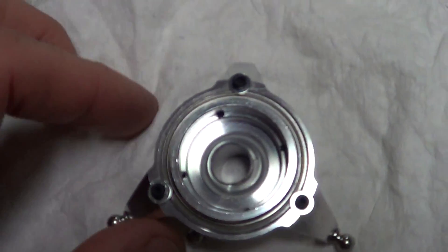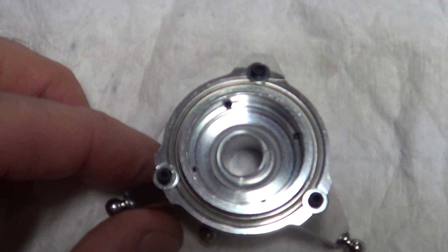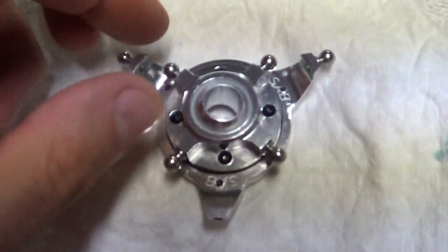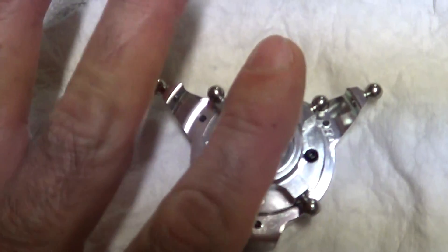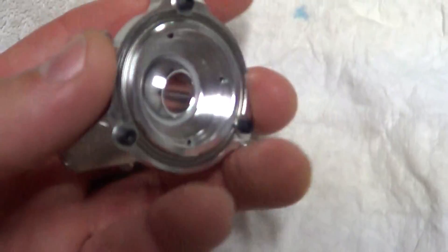What we did was I took this to work. You can use either a C-clamp and use it by hand with a couple of pieces of wood. You put it across there. You have to take out these four screws and take this part of the swash out, then you can lay a piece of wood there and across here, and you can squish the bearing back in there.